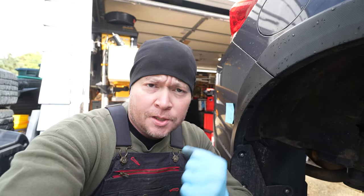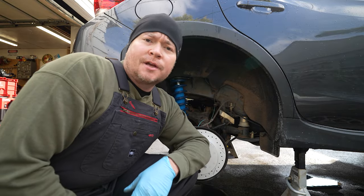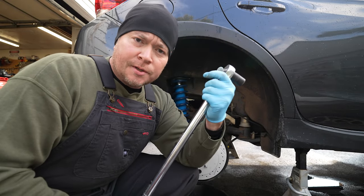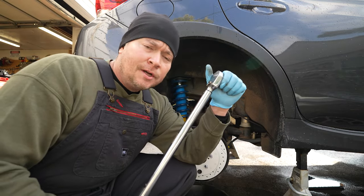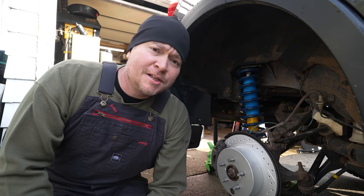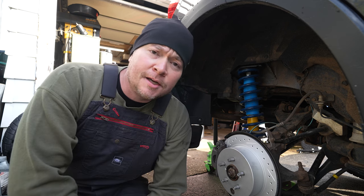One tip if you're not using a torque wrench: I like to go until it makes contact and about a quarter turn more. General rule of thumb — if you're tightening it and then suddenly it starts to loosen, you went too far. If you do like to work on your car, I highly recommend torque wrenches. I got mine from Harbor Freight — the Icon brand series — and I do have one Snap-on 3/8 one that I got from my father. These buy me peace of mind when doing chassis or engine work, knowing things are actually torqued to spec. Alright, that's all there is to it — these brakes are actually not that hard as long as they're not completely frozen. All that's left is to do the same thing on the other side, put the tires back on, and take it for a test drive.